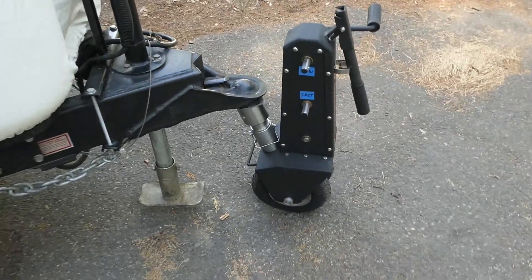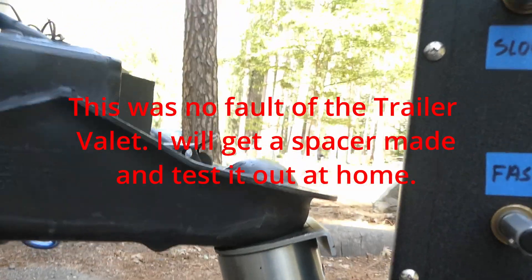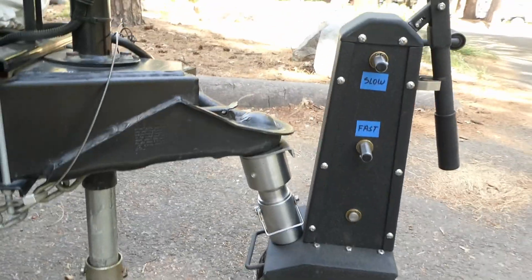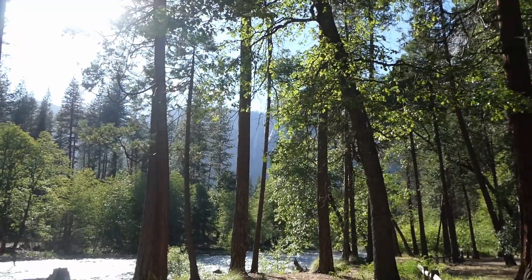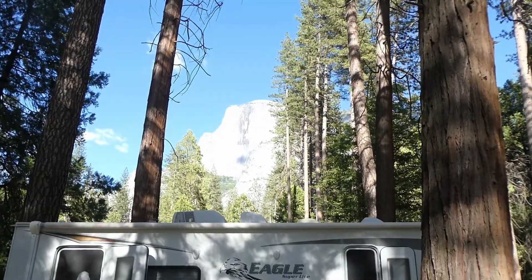The trailer valet was a little bit of a fail to move this big trailer around, because this tongue has this angle here — an angled spacer to go in there — and that angle makes it impossible to turn it. It kind of worked but not very well at all. Yosemite Falls put that nice little feature there too.